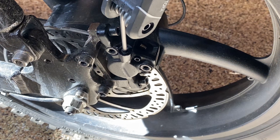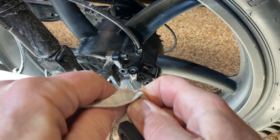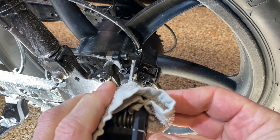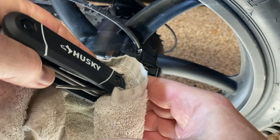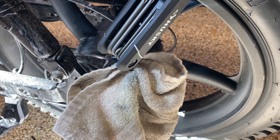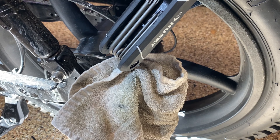With your garage shop towel and your T15 Torx — punch a hole through the towel, do it again. Boom. Now look what you've got: a towel that's going to grab and absorb any fluid leaking out. We're all ready to go. One squeeze of the lever pushing fluid out — you're not going to get much more than a couple of drops — and this towel secured down on there is going to catch it all. Is this not brilliant?